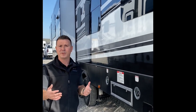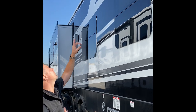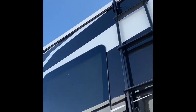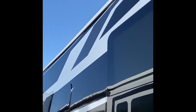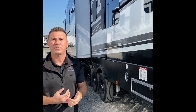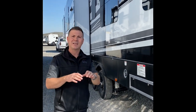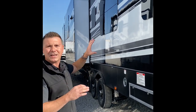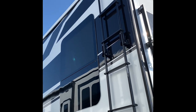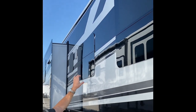that full walkability capacity. Another thing to talk about when we're talking about roofs is that roof line edge there. As you can see, that actually sits down about 4 inches. It doesn't just butt up the sidewall to the roof line like you would see in some of our competitors' products. And what we do there is we actually take a piece of rolled aluminum and we run it down the entire length of the coach. That way, when we wrap the Alpha Flex roofing down, we can come down about 4 inches and run that gutter line there, eliminating the opportunity for a seam to come apart, because water intrusion is gonna be the number one thing that'll kill your RV.